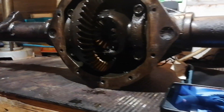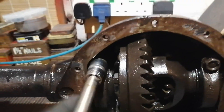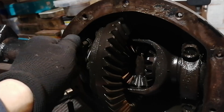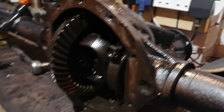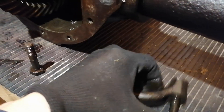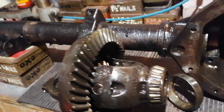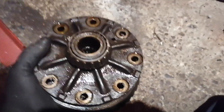I gave that two coats and left it overnight. You'll find loads of great videos for Atlas LSD rebuilds and fitting on YouTube — I'll put links in the description for the ones I found really helpful. Here we are taking the bearing carriers off and making sure I put the bolts in a sensible place so I know where they came from — I try my best to use the same bolts back in the same place. The diff just comes out once you've got the bearing carriers off.